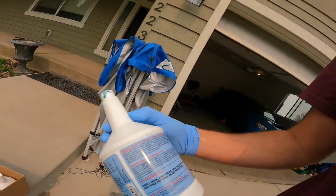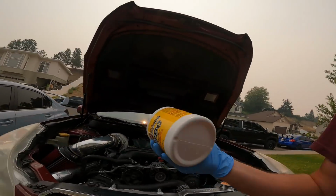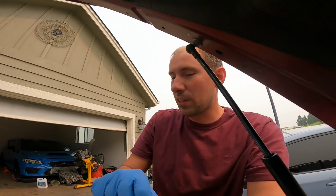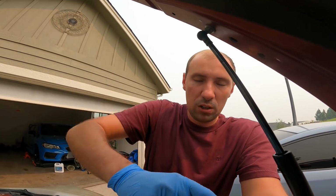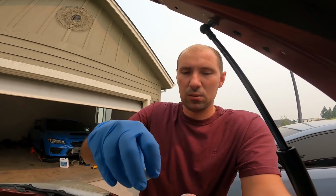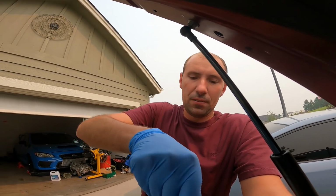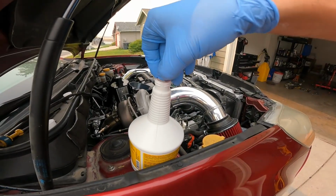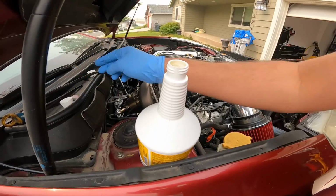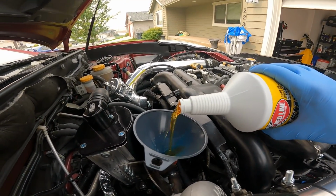So now we've got that done on one of those. We're going to pick up one of these. Not so much a reason to shake this, but we'll shake it. Like I said, I'll alternate. We're going to be hot out here. I'm sweating away. We're going to be putting one of each in, so a total of four, guys, is what this thing will take. And that means one of each being that lightweight shockproof, and then the other being the 75W-90. Now I'm just trying to open this thing up. Come on. This stuff looks like normal gear oil going in.